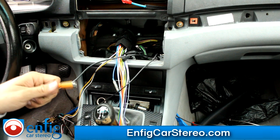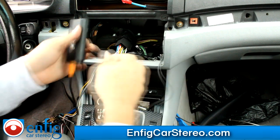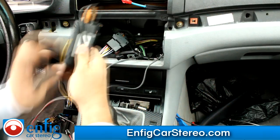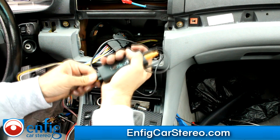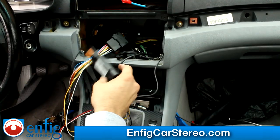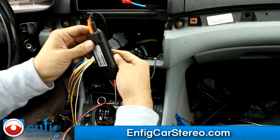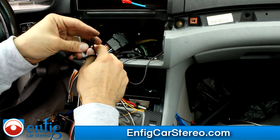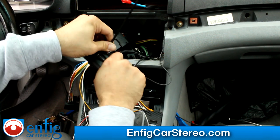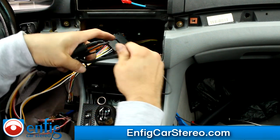Now the box is going to go right here, with the iPod cable and then the aux cable. This is going to plug into here — it has a locking tab. I'm going to grab a zip tie so I can tie around this. I bent it upward a little. The reason I do this is so that way if someone pulls on the wire, it doesn't just come flying out — give it a little snugness.